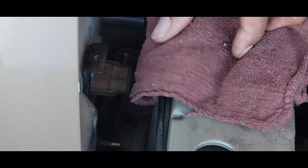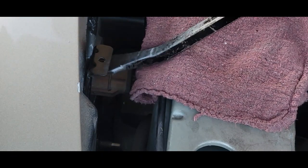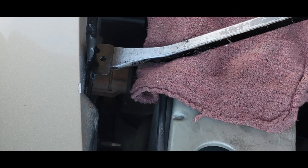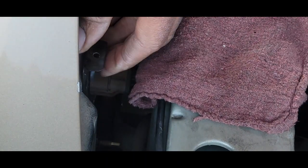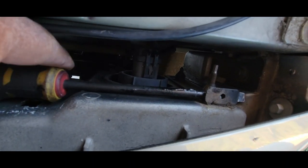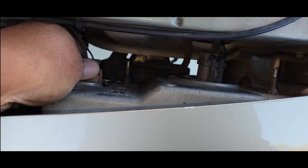Let's go to the driver's side. We're going to put a rag right here, take a screwdriver and put it right here, and just pry it out. Just take your time. There we go — pull up on it. Pull that out of the way. Now over here we're just going to take a screwdriver and use this corner right here. Then we'll push the headlight out.